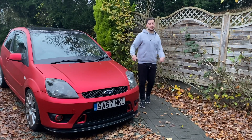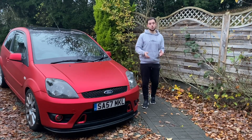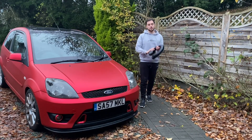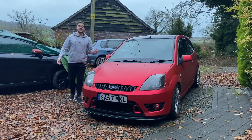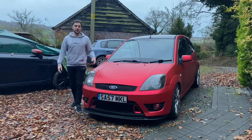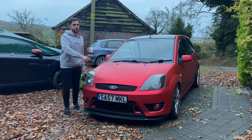For as long as I've been into cars there's been a never-ending debate on intake temperatures and whether cone and pod filters actually reduce engine performance due to heat soak because they're not in a proper enclosure. I was hoping that if we can run some air ducting up to the filter we should be able to get some cooler intake temperatures which will hopefully improve performance. I don't have access to a dyno, but I can measure the intake temperature before and after fitting that ducting from the vents to the air filter.